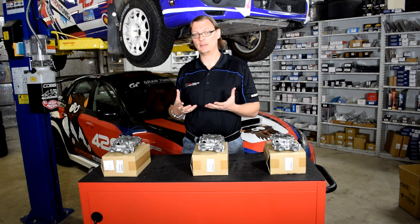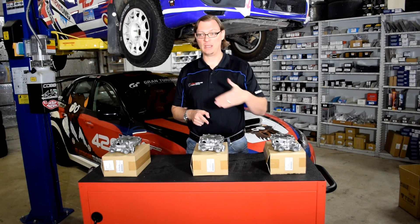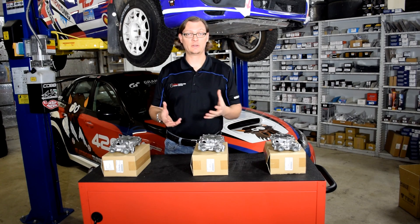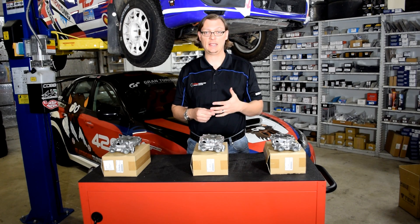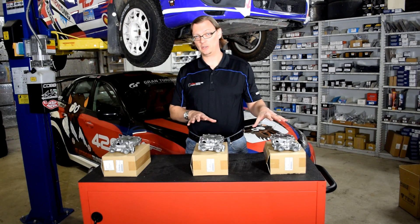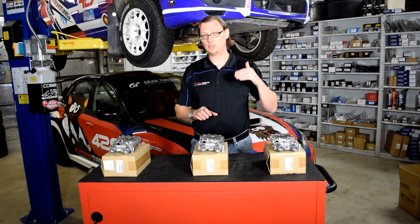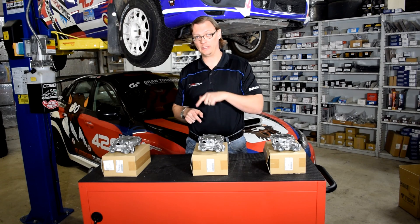The last point: why is too big of a pump possibly a bad thing? All of these pumps have a relief valve — there's a maximum pressure they will hit, and then the relief valve opens and the oil gets put into a holding pattern around the pump. You don't want the oil sitting in that holding pattern any longer than necessary, because as it goes around and around, you're heating that oil up, which can compromise viscosity and possibly froth the oil, which can also compromise pressure and viscosity. With too large a pump, you hit that relief valve pressure much sooner, so oil spends a lot more time in that holding pattern.